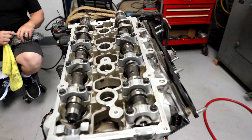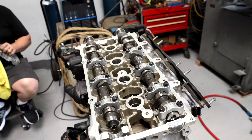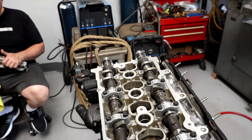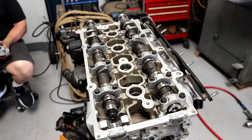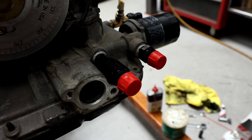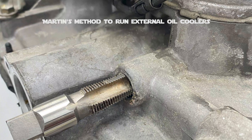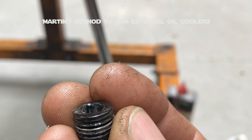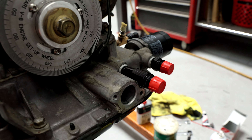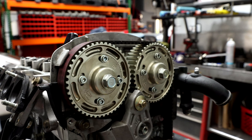That's about it for day two. You guys can see the progress we've made prepping this engine. Tomorrow we're going to come in and set the cam timing with the Toto Racing gears, and hopefully by the end of the day tomorrow we'll have this thing back in. Martin got in first this morning and made modifications so that he can run external oil coolers. Steve's got his timing wheel on already and the Toto gears are on — we're going to be setting the cam timing in a little bit.